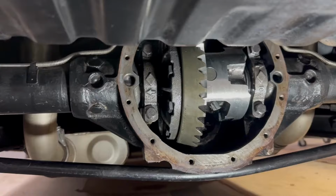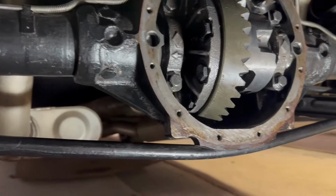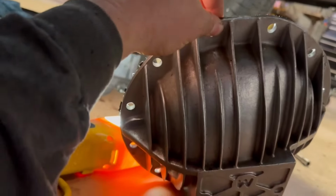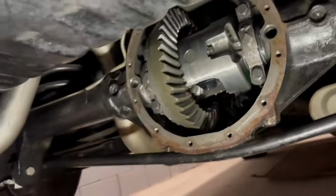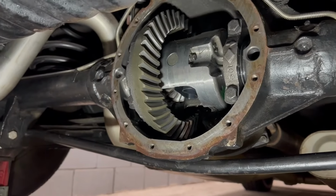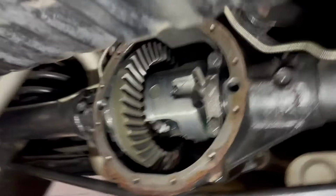This is an O rear, and it's basically an Oldsmobile exclusive rear end. You won't see it in Chevys. What it is, a 12-bolt cover, not to be confused with the Chevy 12-bolt cover, where you can ascertain that a 12-bolt cover in a Chevy is a 12-bolt rear. Such is not the case here in Oldsmobile, in the confusing world of Oldsmobiles. It's a 10-bolt ring gear. It's an 8.5-inch ring gear. It's a 10-bolt. It's got a little larger bolts than you would find in a Chevy rear.